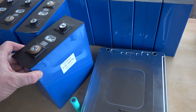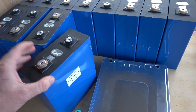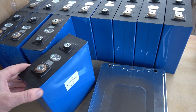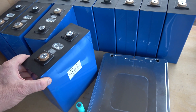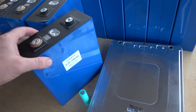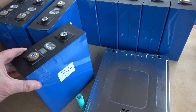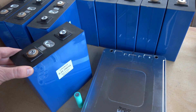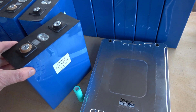With these Ford Ranger electrics, one of the problems some past conversions have had is not using a battery with sufficient power density to power the motor. The Ford Ranger electric has basically a 90 kilowatt peak power motor based on the controller's limitations — a voltage limit of 380 volts, so a maximum of 90 kilowatts. People using 100 amp hour lithium iron phosphate cells — if they're only capable of a sustained 100 amps of output current — and you're using those in a battery pulling upwards of 250 to 300 amps, which the regenerative braking system might produce, you're going to outstrip that battery.